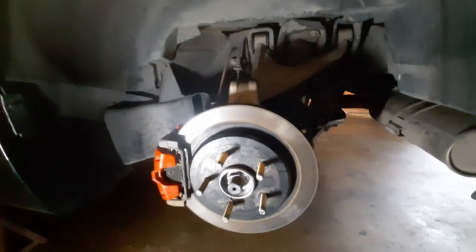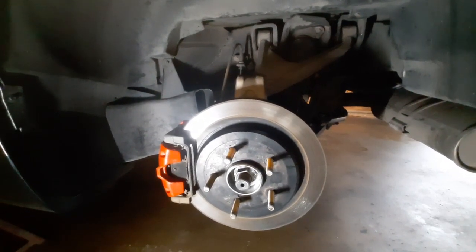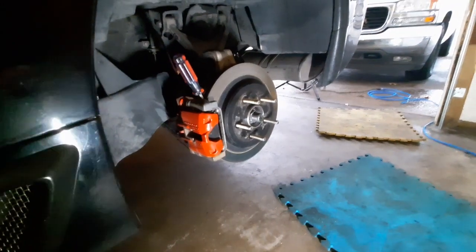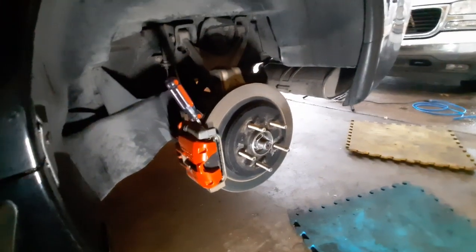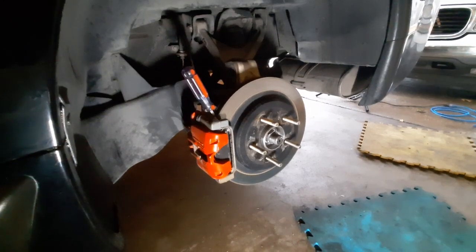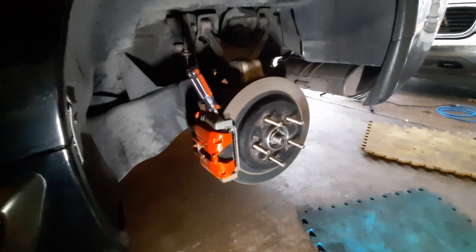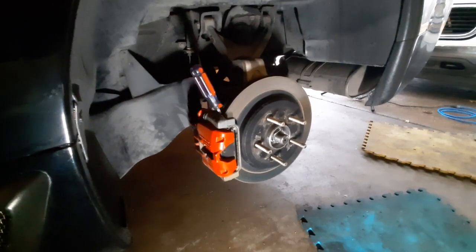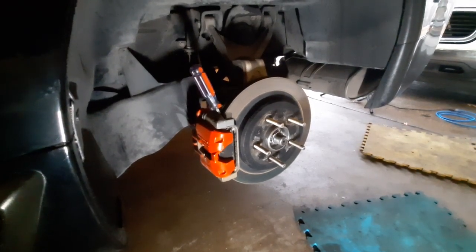I put the screwdriver on the other side and checked the other side — the breakaway torque is almost identical, so nothing is seriously damaged in the clutch packs, they're just worn. Later on this winter when the snow starts to fly, I'll pull the differential out and completely rebuild or replace the clutch packs with the newer carbon fiber stuff out of the C6s, along with a new Belleville spring.